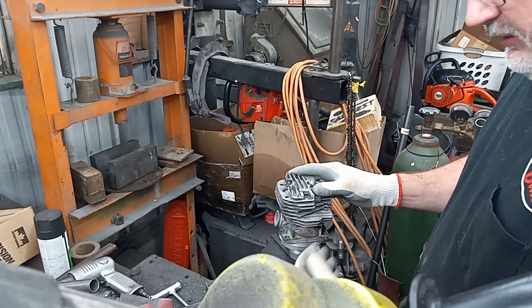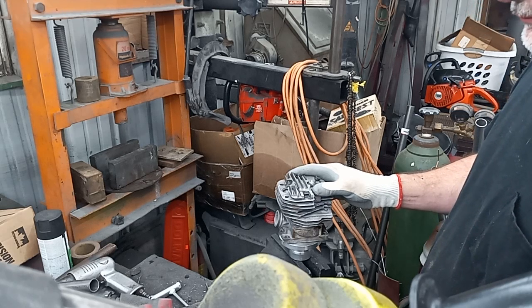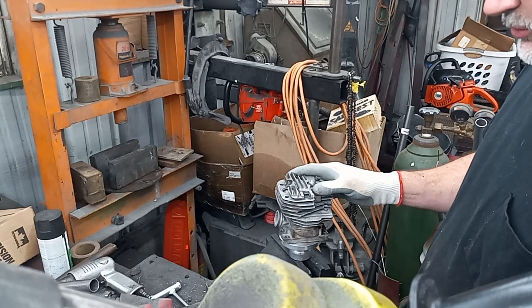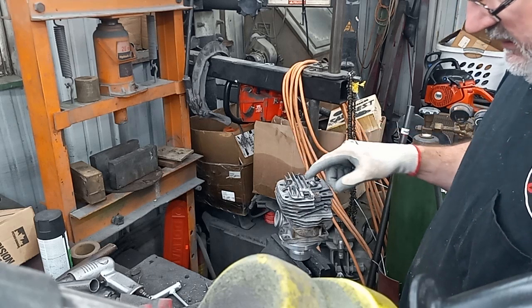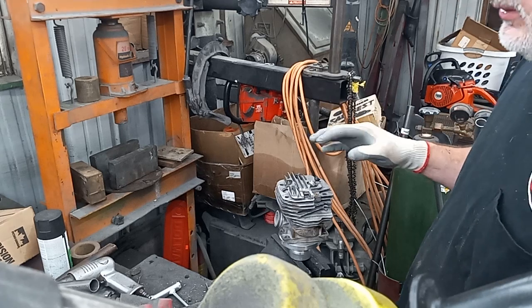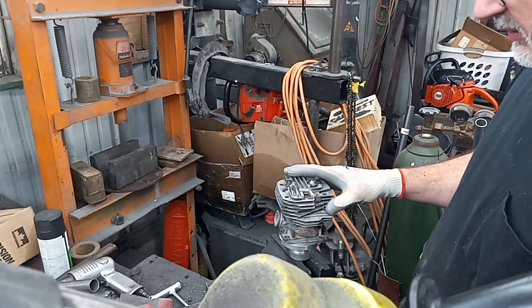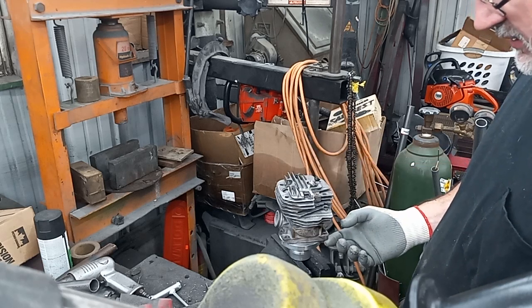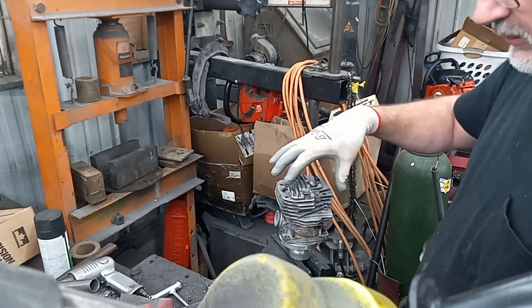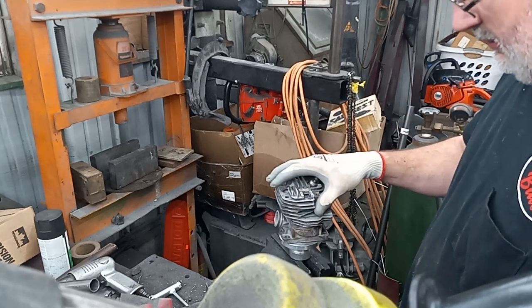And then if you wanted to go more than the 2 razor blades, 3 is probably too much unless you're doing some sort of crazy build. But after I cut it, I can put this in the lathe if I want 10 more thousandths out of the, say my squish still ain't where I wanted, or I want to take a little more out. I can shave 5, 10, 15, whatever I want off the base on the lathe, then come back over and you don't got to keep readjusting this.